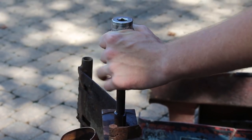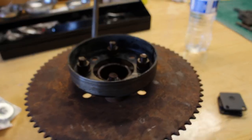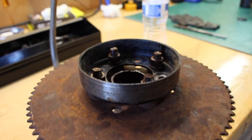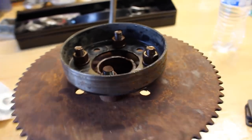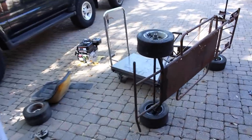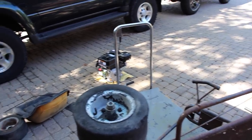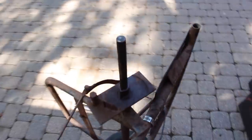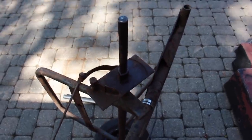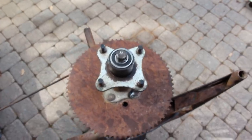Alright. So we got our new brake drum and band — I just threw that one on. Well, not new, but less crusty. I just put that on, and the Predator is done getting all warmed up. What we'll do is let it cool down, then start it again, let it cool down one more time, and change the oil because it'll have a ton of metal shavings in it. We also need to clean up this shaft before we press any new bearings on it. We got the brand new bearings on there, as you can see, and it spins really nicely.